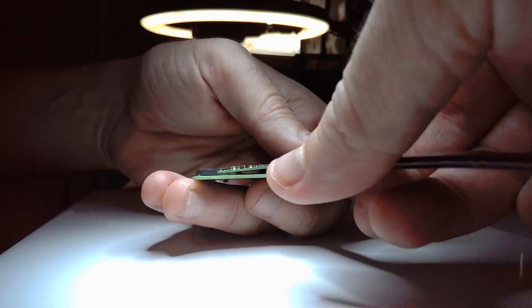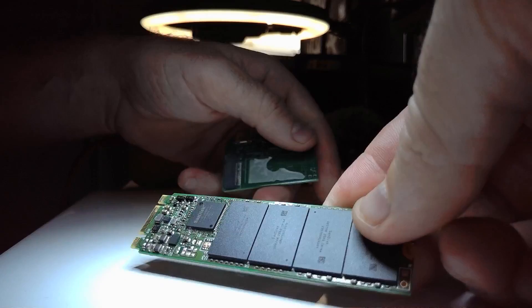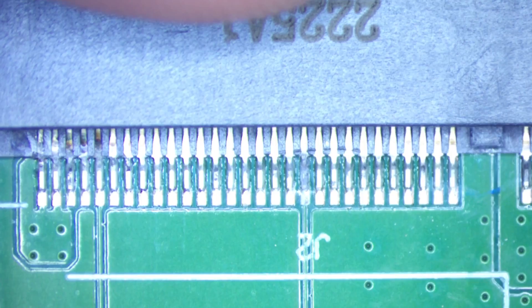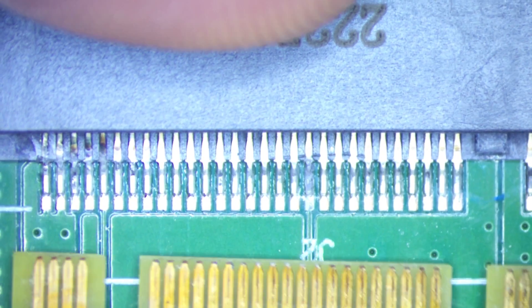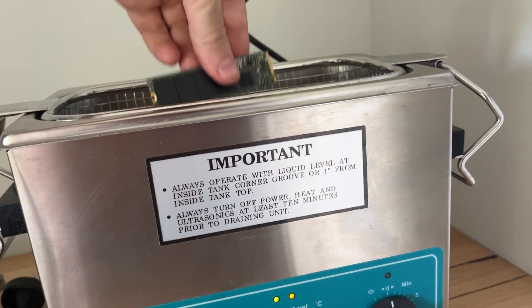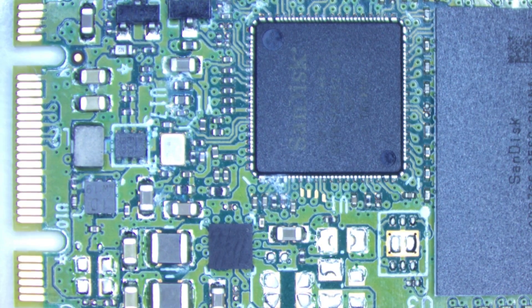I'm going to separate this SSD — just got to get under and break this double-sided tape, and once you do it'll pop out. We'll put it in the ultrasonic cleaner. If you have a look at the adapter pins here, you can see that this liquid has gotten through everything and corroded everything, even on the back. You've got this white pasty gunk everywhere. Looks like something hit it — a bit of water, who knows. Here's a before shot with all the corrosion all over the SSD.